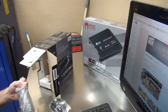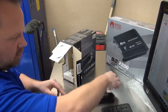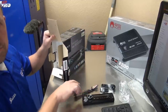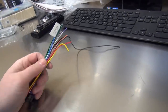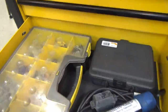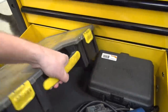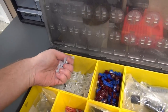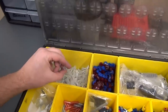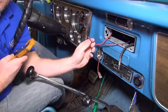Pulling the radio out of the box — you've got a base plate, a microphone since this is a Bluetooth radio, and the wiring harness. I prefer to use these white cap connections; they make a better connection than butt connectors because you can twist the wire together really tightly and you're only making one crimp connection.